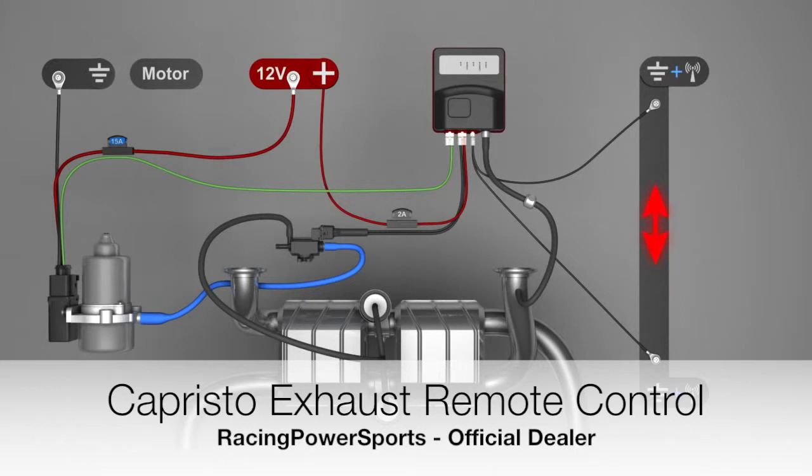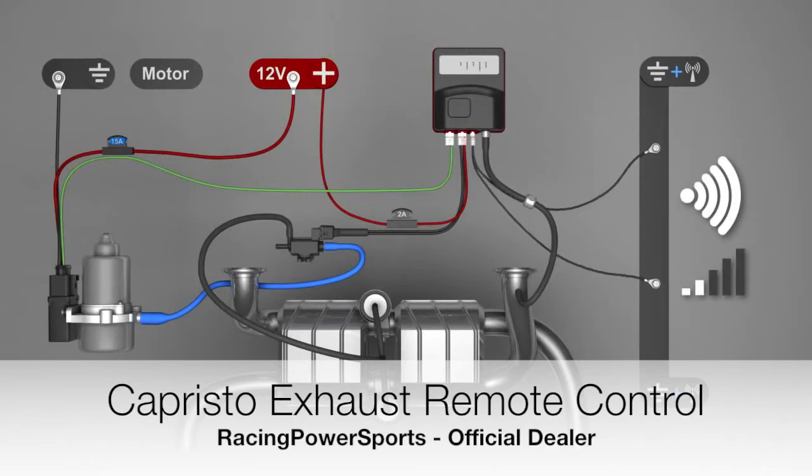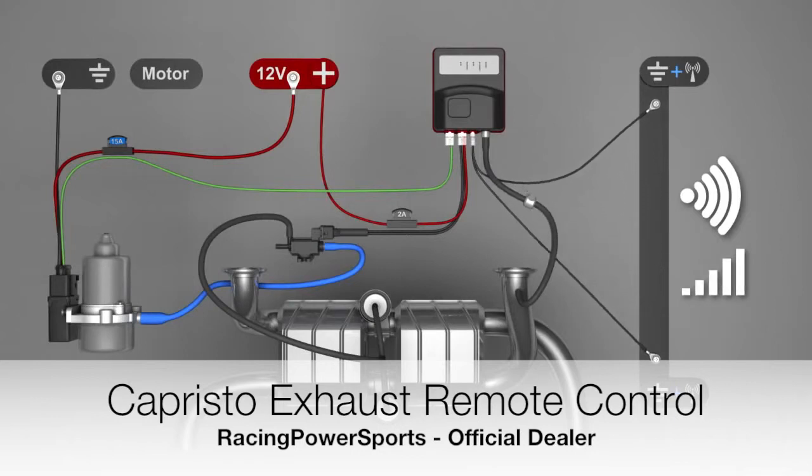Third, the ends of the two antenna cables must be fixed as far apart as possible to a grounded metal element — they then resemble a ring antenna. The smaller the distance of the two cable ends is, the weaker the transmission power of the CES-3 becomes. When the car radio does not receive an RDS signal, the distance between the cable ends must be increased. These antenna cables are also the ground wires for the power supply. Fourth, this device may come without antenna cable; in that case, only the ground wire has to be connected. Fifth, this connection of the solenoid valve must not be used. The magnetic valve has a fuse of 2 amps, and the optional vacuum pump has a fuse of 15 amps.